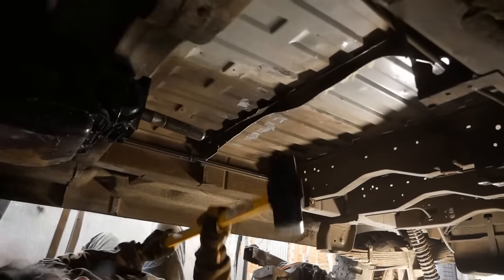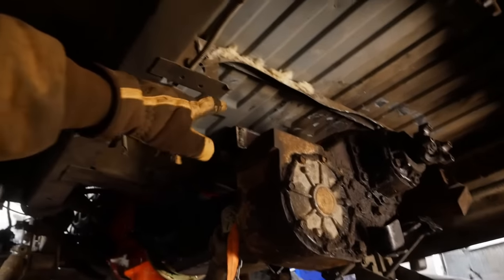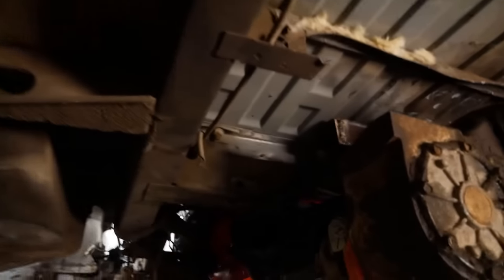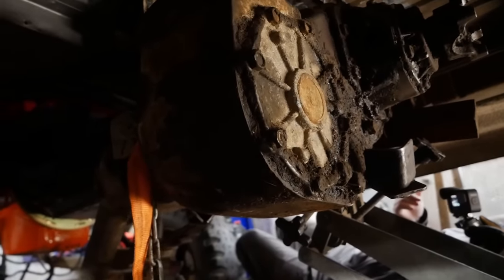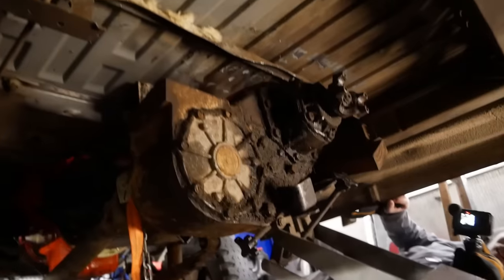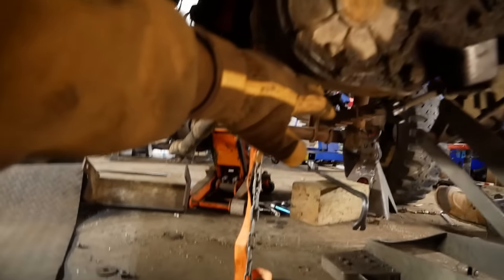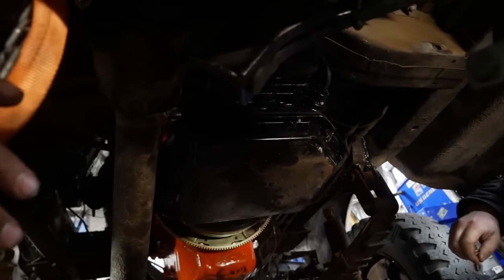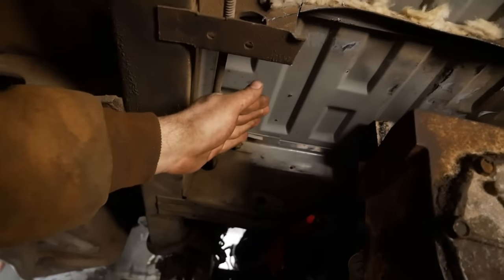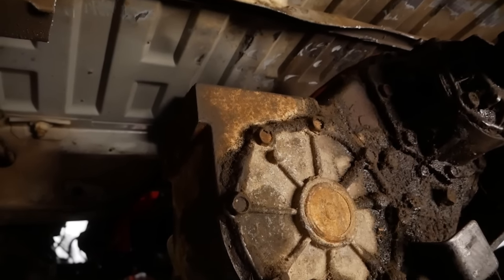We were just test fitting with the beading that I provided to the bottom of this floor, and it fits now - it lowered the transmission, which is always good. We fixed it - it doesn't matter how. It's splined on there and everything. The drive shaft might even go on. We still got to get bolts in and stuff, but I just wasn't expecting this to actually work. We're going to have to drill holes through the floor and through these bushings, then bolt in the ears through the floor. If we sandwich it through the floor it'll be stronger - it will just hard mount this whole thing in here, and that's going to be better than those bushings anyway.